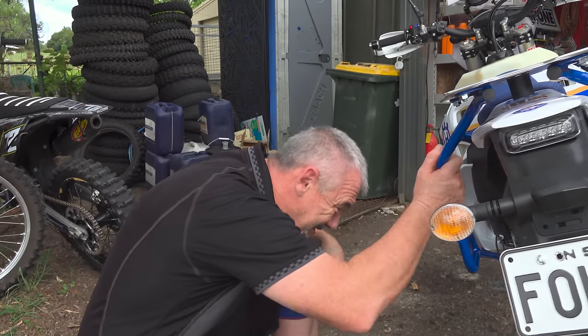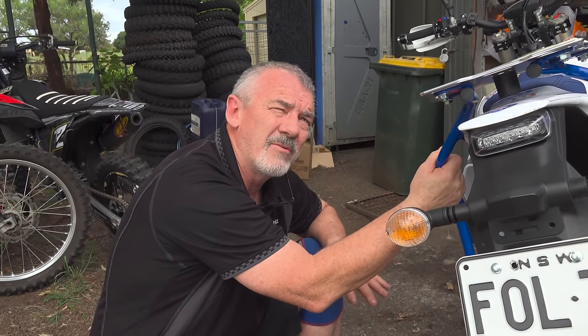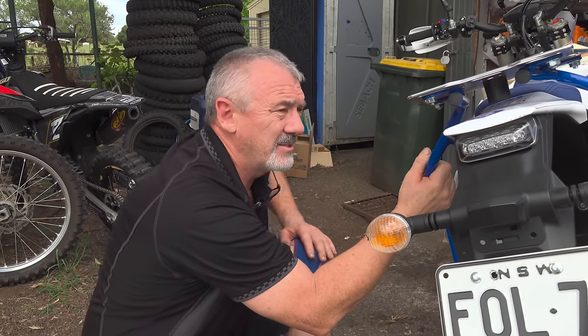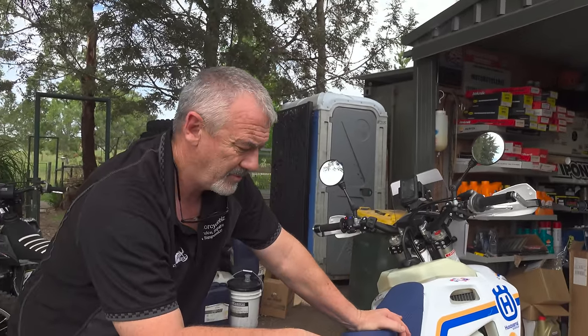Yeah. Did you change your gearing at all? No, I left the gearing standard at the moment. Yeah. You're going to go one up on the front and... I'll listen to your advice on that. Yeah, well, I'll see how it goes, I suppose. You might want to go up one tooth and just stretch its legs out a bit more. Yep. If you're doing any sort of transport or highway type sections.